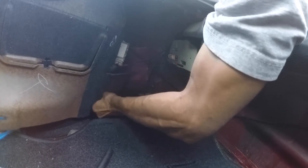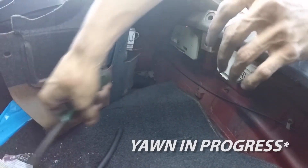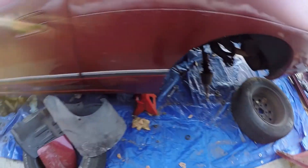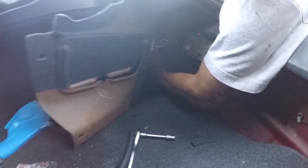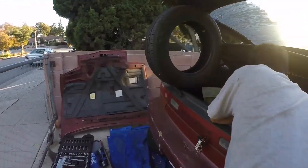There's a box here. Yeah, there is. How the — and there's a 10mm holding it. That's not a 10. I have no idea where my 10mm is. Alright, so we are removing this bumper. There are three 10mm little nuts and a box wrench bolt on each side.